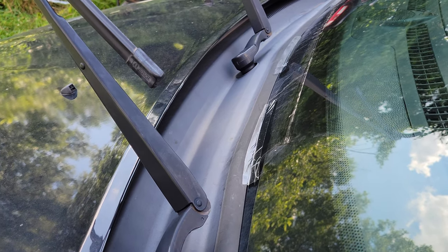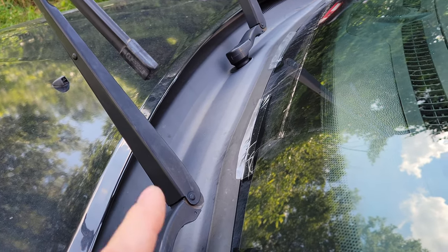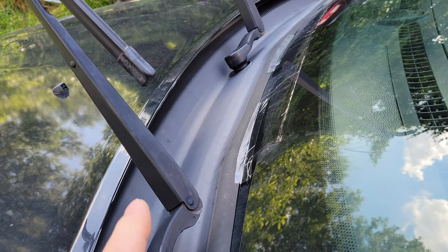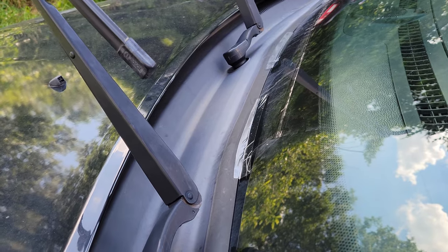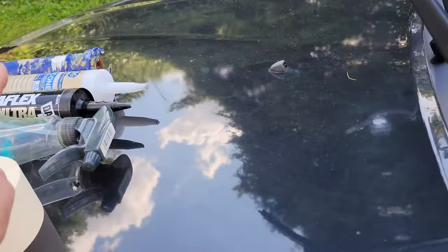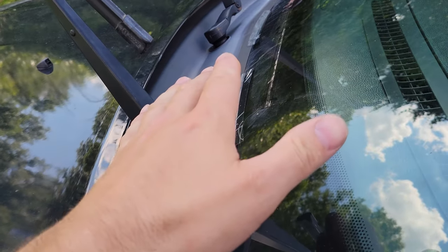The idea is that we're going to seal this off and stop the wind from coming through. More importantly, this seal is here because it's supposed to prevent dirt and moisture from getting down into your vehicle, which is just as important. We're going to use some silicone here, apply it to the back side, then press and tape it against the seal and let it sit overnight.